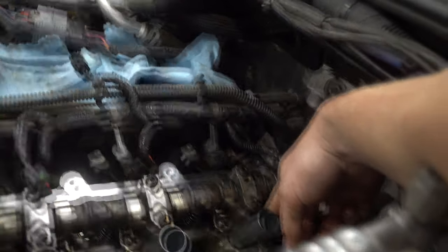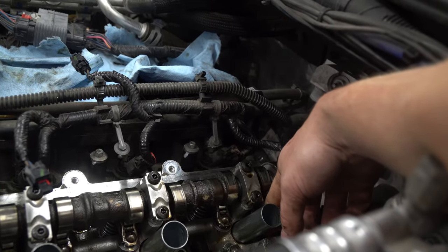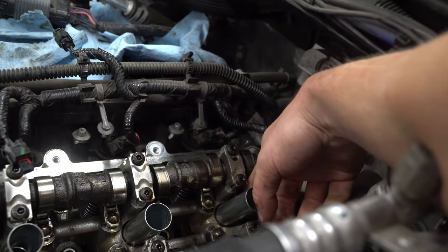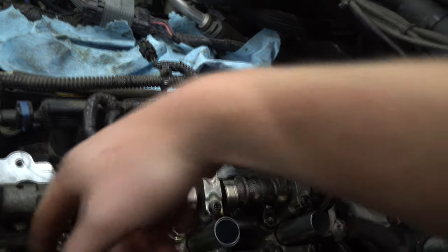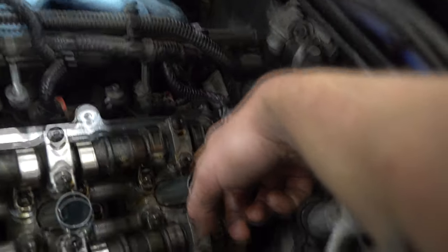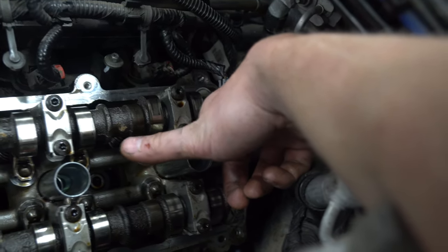That's not so bad, but this one — I'm going to do it with one finger. Hear that? I'm just tapping it, barely hitting it, and the lobe is kind of half down on this one. Let's see if I can get a better shake — the problem is it's the absolute last one. Hear that? I'm shaking it like this, just to show you — with this finger, look how much pressure I'm using, almost none. Here on all of these there's no shaking, no movement. But that one right there — just the tip of my finger — that is my dead one.